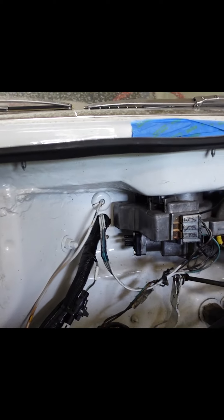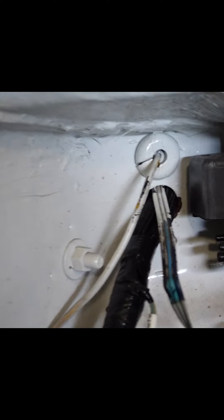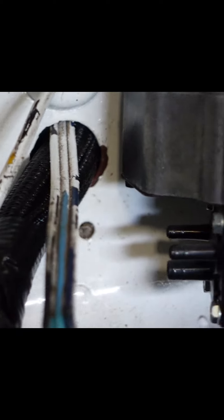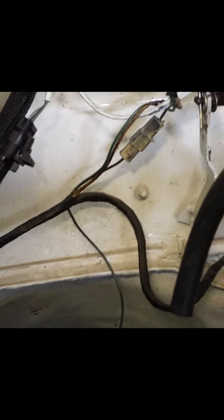One major thing I see is that big loom of wires passing through there and we don't have a grommet on that. Also, three of those wires are sitting on top of another bundle - that could really chafe through really bad. So we're gonna clean up a whole lot of this wiring. We're not touching the brake system.